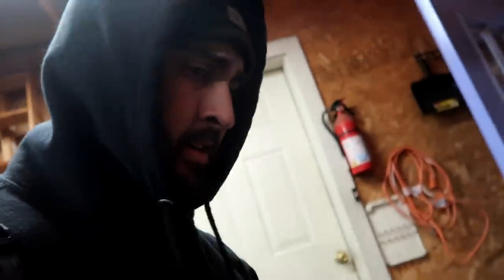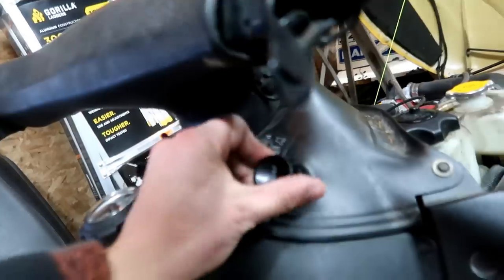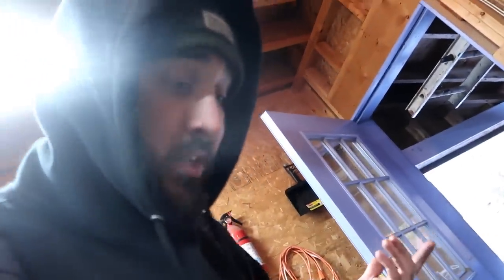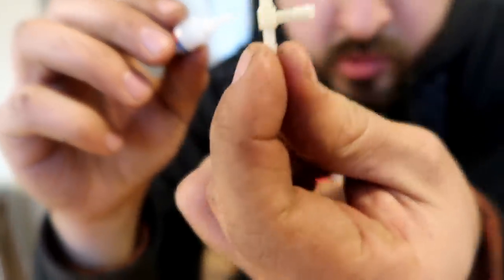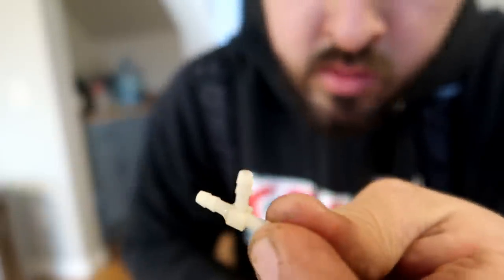I don't see any leaks — that's good. There's a possibility the fuel pump is bad; the new one we got may not be working correctly. Something I noticed off camera: I could keep it running at around three to four thousand RPMs, but it looks like it's sucking fuel from the primer line constantly as I'm revving it — that should not be happening. I'm wondering if I have a bad primer that's sucking fuel and running off the primer without me pumping it. Unfortunately the primer T that goes to each of the carbs snapped off on me. I said screw it and super-glued the T back together in its original position — I did not want to wait five to seven business days.